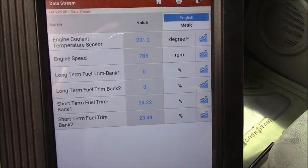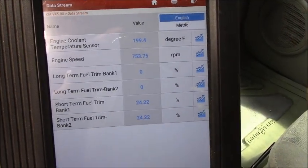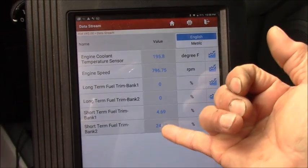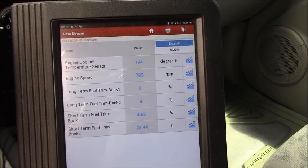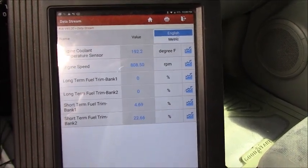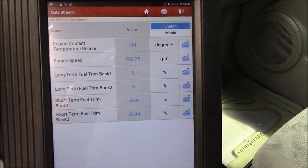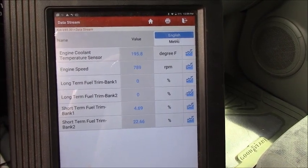It's not only the cam sensor, and there might be something else later if the software is jammed like this. Right now, I don't see anything wrong with the sensor. As you can see, 4.69. Okay guys, the main thing of this video, we tried to find the problem, but for me, I don't know what to do for now. Change the sensor, I'd rather not. Don't try, no maybe. And we already checked the harness shaking, there's still no intermittent problem. When we let the waveform run, we don't catch anything.